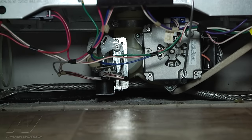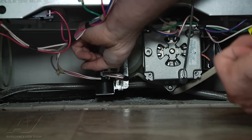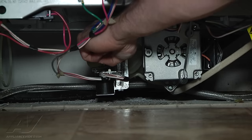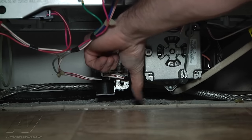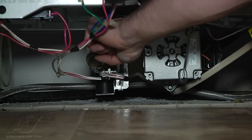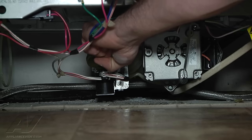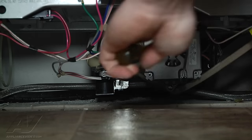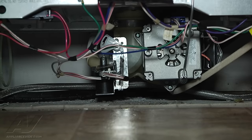What we've got here on the underside is the drain solenoid. During the drain cycle it will energize and pull down on the diverter. The motor will stay running in the same direction — it just pulls that down and diverts the water out the drain line. A lot of times where you'll get your leaks are right up here at the seal when that's in the drain cycle.